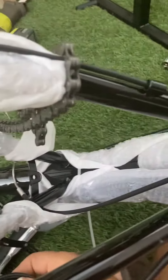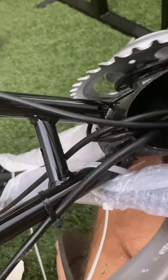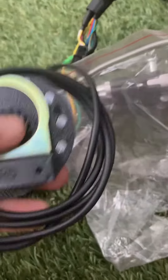Then you're going to replace the old sensor with the new sensor and plug it in. I wouldn't thread it all the way through until I tested it first. Test it and see if it works — it should work, especially since you said your arrow-up button works, which means the whole system is still working. The engineer thinks it's the sensor.